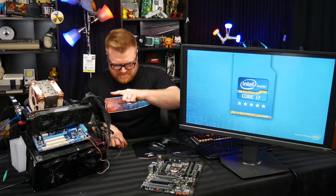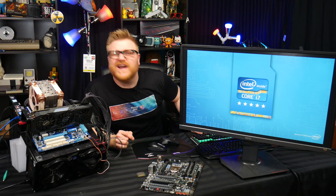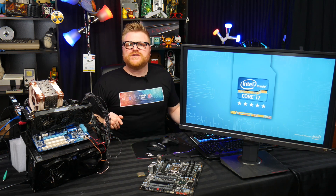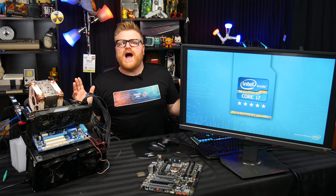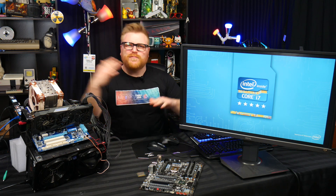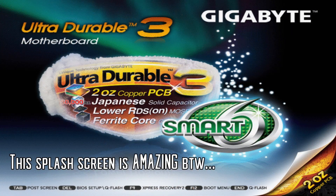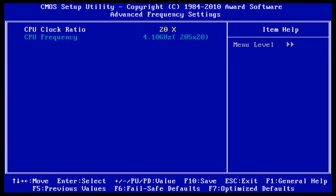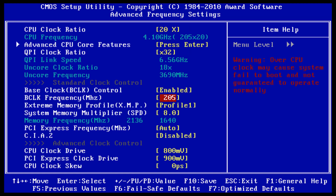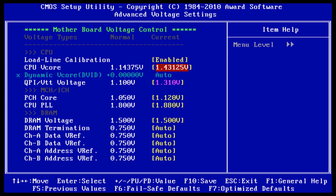Which is of course a very blue ultra durable motherboard, but it does the freaking job. I have this i7 first gen 860 at 4.2 gigahertz — isn't that crazy? They weren't meant to do that, and it overclocks like a dream. I got a really lucky one because I heard a lot of people were having trouble hitting 200 BCLK overclock. These are locked multipliers — you can bring them up a little bit but they're locked at 21 or 22. So you are BCLK overclocking, and you can't change the uncore like you can on the X58 platform.